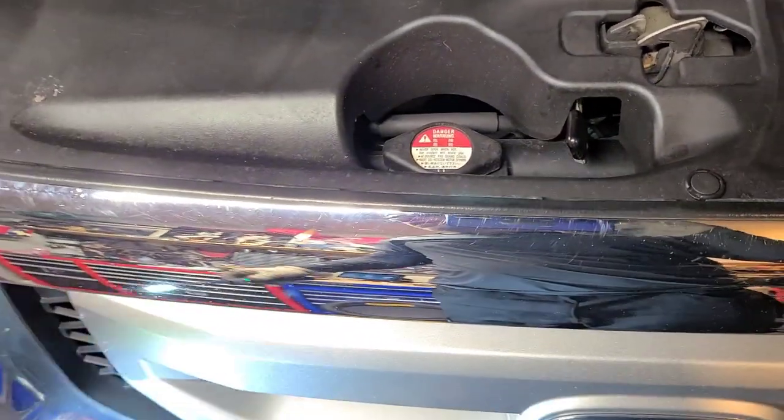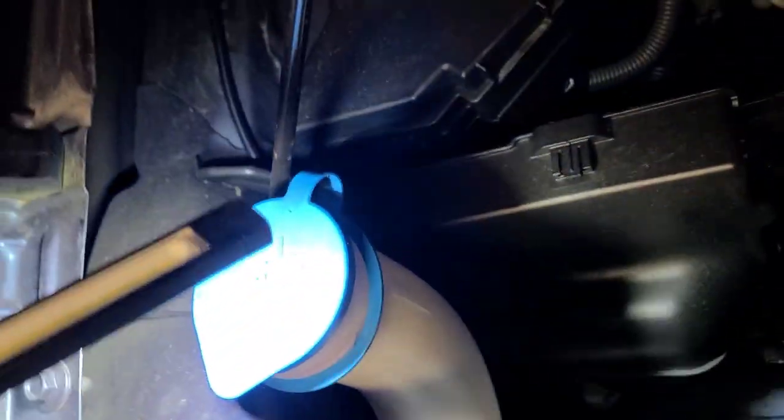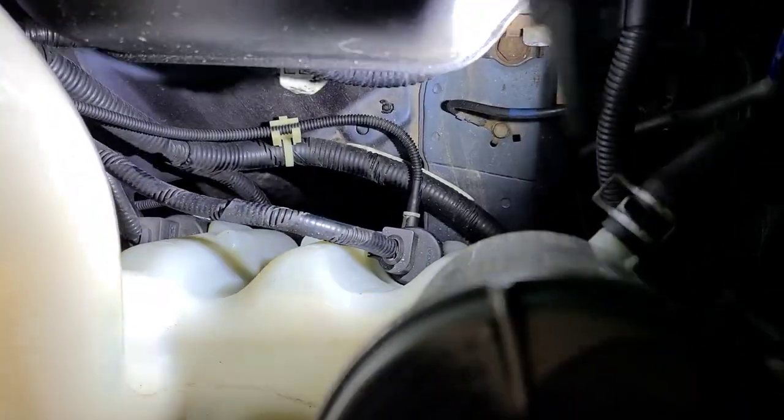What's good, back with another video. Today I'm on a 2009 Honda Pilot. We have a windshield washer fluid leak and I noticed it starting to leak right down there. Up top you have your engine, power steering, coolant reservoir overspill, and then your windshield washer fluid. If you look down in here you'll see a wet spot. We're leaking, and you have two washer motors — one on this side, one on that side. It's leaking from that one on the far side. I'm getting ready to take the wheel well cover off — I think it's leaking from the rubber grommet down there.